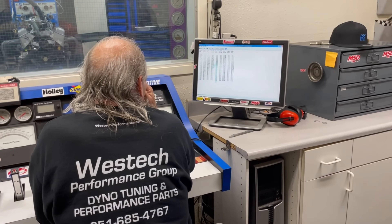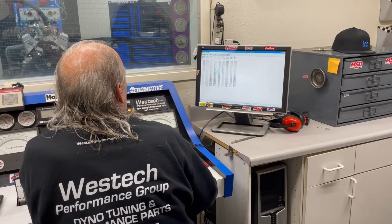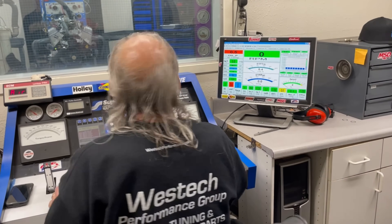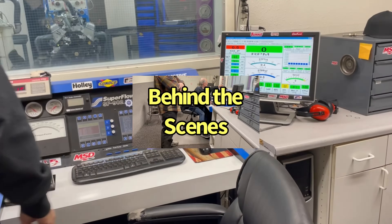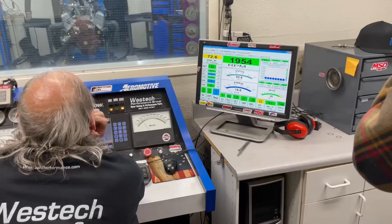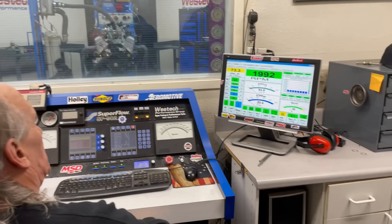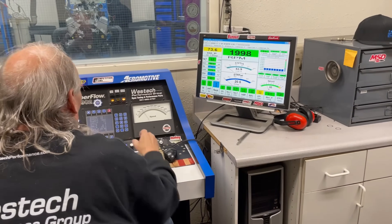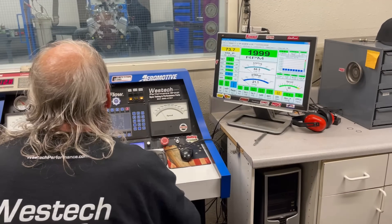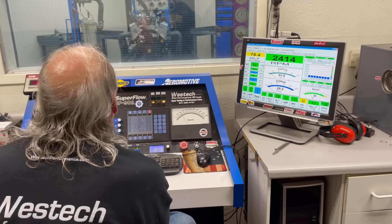Well, you just want to blend, you know. Like I said, you're not concerned about mileage — you're not going to drive it that much. But it sits down in that car. Well, it'll feel a lot better than a 383 does. Anybody get enough jet in it, Steve? Not too much in the back there — take some out. That's better than being the other way though, right? It's not enough to start with, so we're kind of too lean, too rich. And hopefully now it's your play — you've got to take big swings at it.